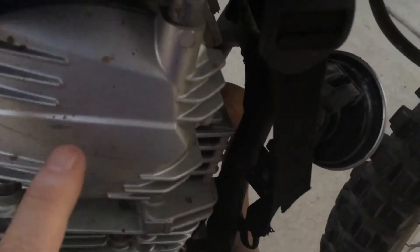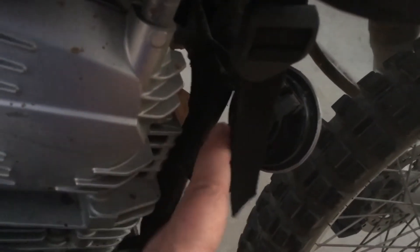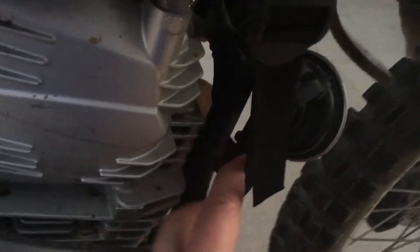On this side — and you may have noticed — the XT 250 engine sticks out further on the right side than the left side under the frame. I was really worried about this side being too close to the engine, but by going around the bracket near the horn, there's plenty of clearance. I've tested it mid-ride to see how hot it gets, and it's fine — it's perfect. On the other side, I'm running right down into that triangular bracket with the clip, and on this side you have even more room, so no problems at all.